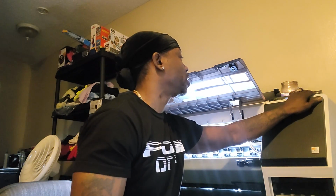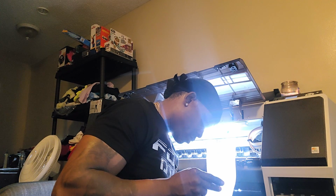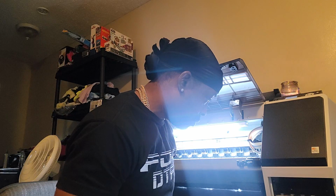So let me go ahead and do another power cleaning. Even though I got a perfect nozzle check, we're going to do another power cleaning, because I've got to bring those colors that I see through. We've got 4 whites, and that one channel that's supposed to be a white is not a white, it's actually a cyan, but it's perfect. So I'm not going to do any initial fills, I'm going to do a power clean, because it's going to push it out. I know for a fact it is. So that right there is where we're at.